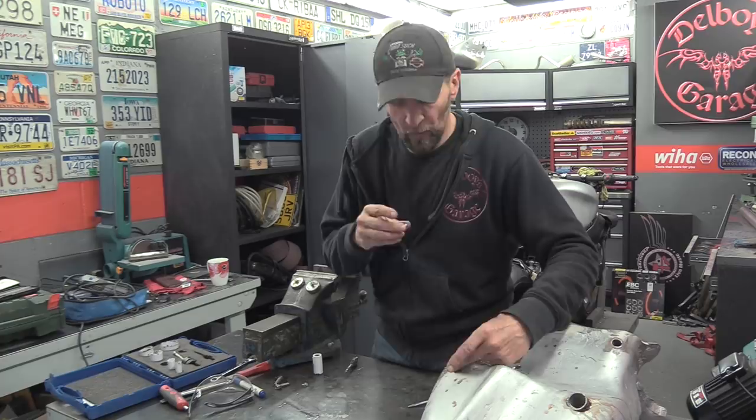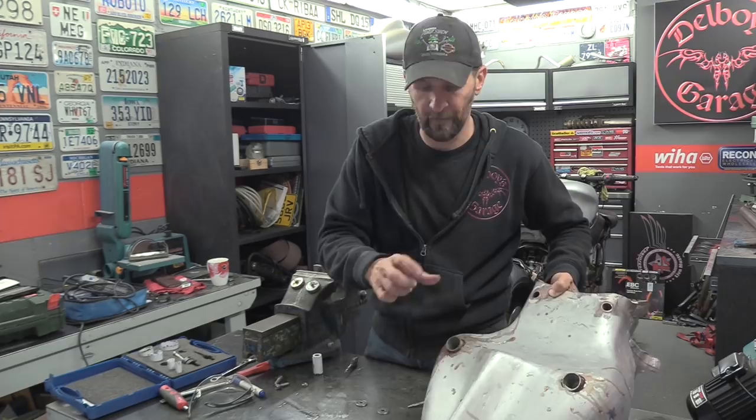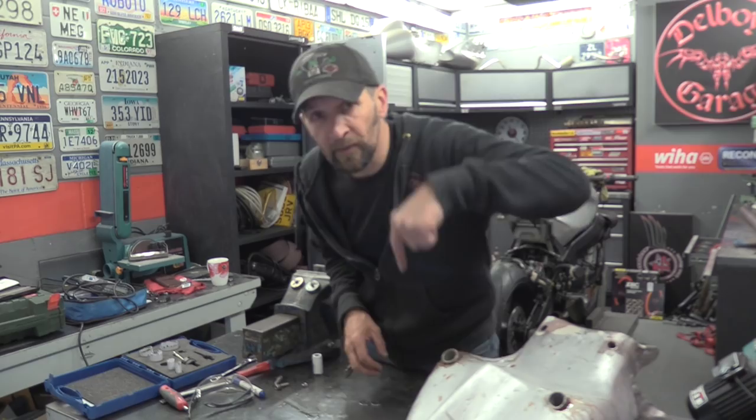Now, what's in the bottom now is, because I had to put resin down in the bottom of these holes to flow round the bottom of this tube and glue it in permanently, there's like a meniscus of resin there, like a curve. So the bottom of that hole at the moment is that shape, not nice and square. So if I put these in now, they're going to sit way high if they even reach the bottom.